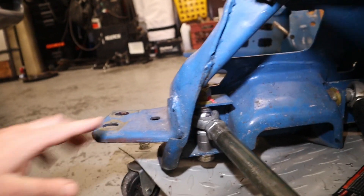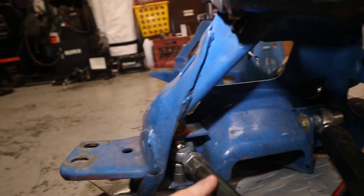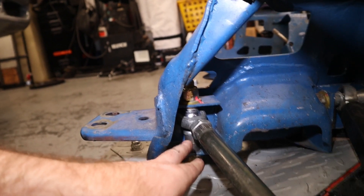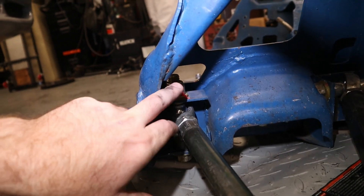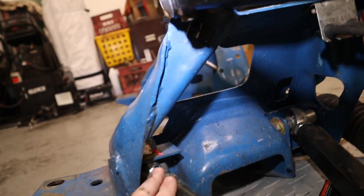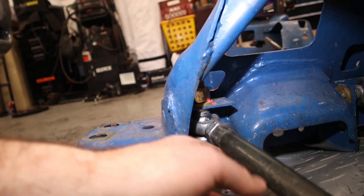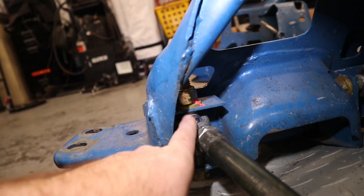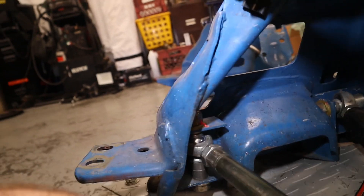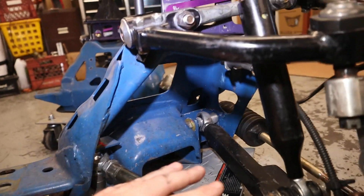For the rear mounting, since there's a plate back there that limits putting a bolt through as you can in the front, I actually turned it 90 degrees — I had seen other suspension systems do this. There's a bracket welded in there and I'm able to shim it up easily, keeping it basically at the same height as the front. I can change that height very easily by just relocating those shims. There's a high-misalignment high-angle ball joint in there of the proper size, so it's never had any issues with binding — it can go way more than the suspension actually needs.